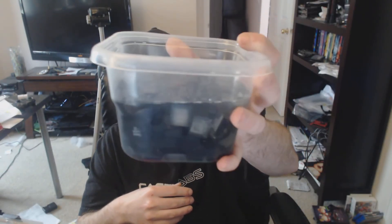If you want your keycaps really clean, you can see all these keycaps I have soaking in warm soapy water to get rid of any grime. Some of them have sticky residue — probably from spilling soda or eating and being careless. You can see this one still has some gooky stuff that's coming off, and there's even some yellowing on one cap, so that's getting taken care of right now.